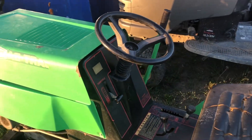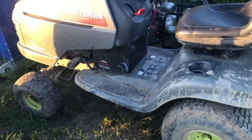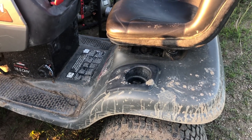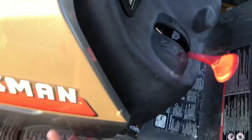Here's my gray lawnmower — I actually got it running. With this one, it dies at 35 and when it dies it won't start, and it makes the starter stick. I was like I need to look at the starter, but turns out my battery is at 27, so no wonder it wouldn't start. I usually run it for chores, that's why it's a little dirty. It's running and driving fine now.